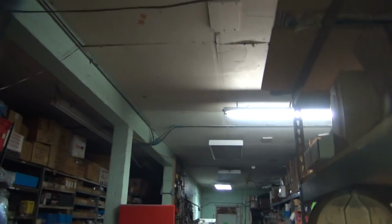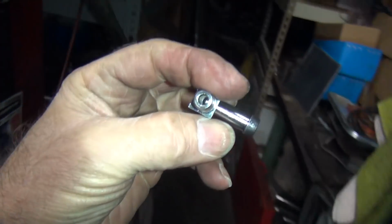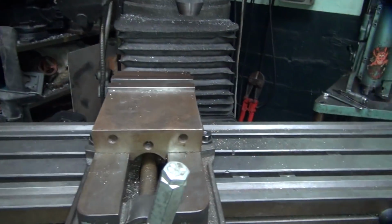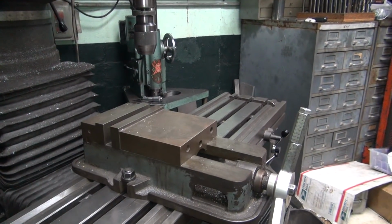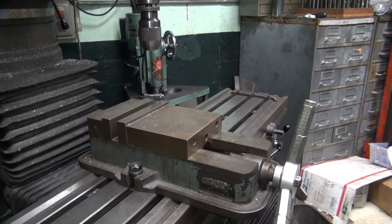Okay, tripod's too tall, banging on everything. Okay, so that's why these things have to be opened up, so you get some oil flow. When you have a fitting like that on your oil pump, you'll have very low oil pressure. It's not sucking air. It's trying to suck oil, but all it's getting is a big vacuum, which overloads the whole system and makes it not work. And your motor does not like that.